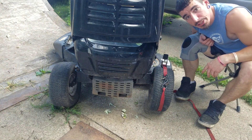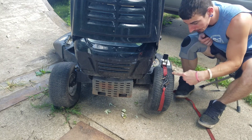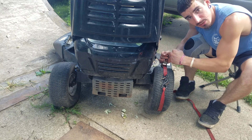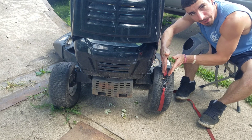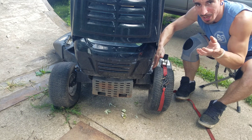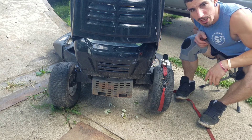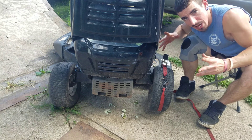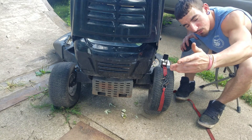What we have to do — I've got air in the air compressor, I've got a ratchet strap. Strap it around the tire and ratchet it down a little bit, and that's going to allow the sidewalls of the tire to expand outwards towards the rim. So that will kind of pre-seal, if you will. Then you shove some air in there, hopefully enough air pressure gets in there to where it just blows it right out and the seal continues, tire pumps up. We move on with our lives.